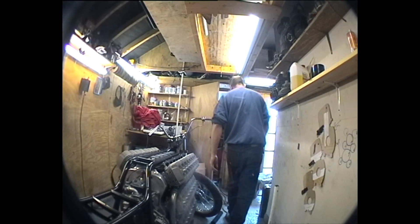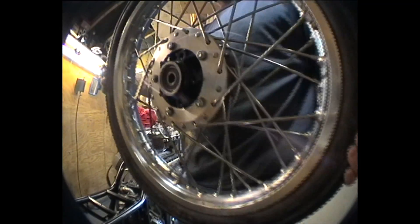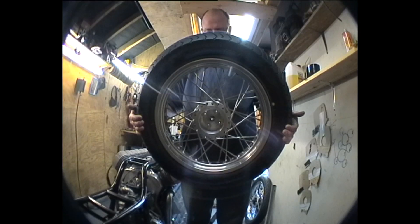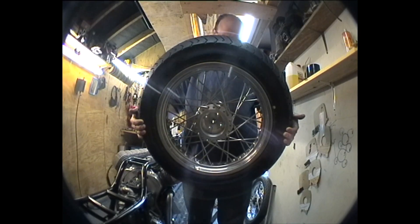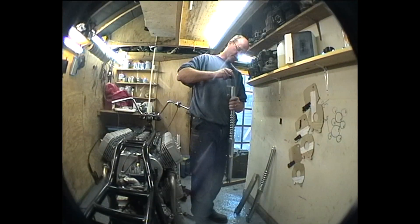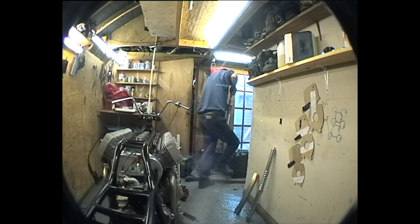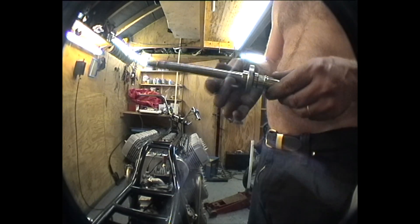Morning — been for a long drive. We have a couple of new arrivals in shed land: front wheel number one. The front forks are standard Gold Wing — not strong enough to take the weight of the bike in compression. The rear suspension units were off a Harley-Davidson aftermarket, which you can increase the air pressure in — air assisted. And here is the wheel spindle, which I had nickel plated.